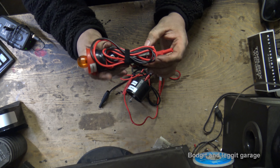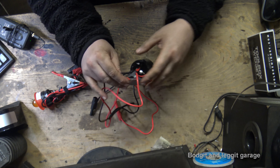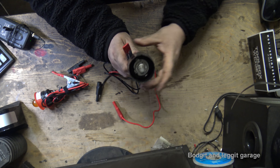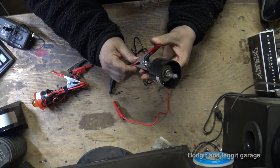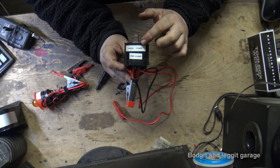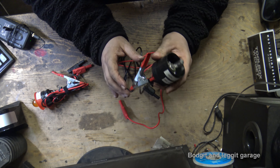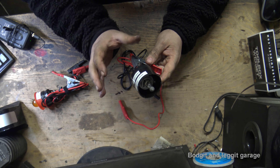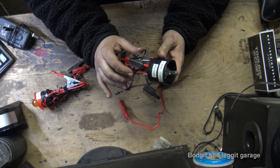I like to pack mine up like this — I have velcro strips that hold all the wire together, it keeps it a lot neater. I have clamps so I can clamp it, because especially with the H7 bulb it can get very hot and if you leave it down you can burn yourself, burn carpets, burn seats, burn wires. I also put on it the inrush and the draw current — the inrush is 9.7 amps and the draw is 4.4 amps. I like to note the inrush because you could be working on a sensitive module that doesn't like a high inrush current.